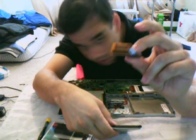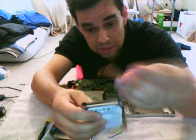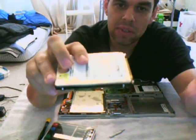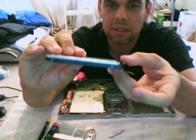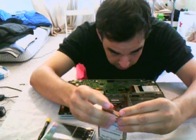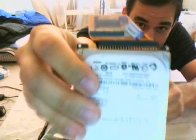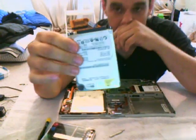Installation is just as easy. This is an idiot-proof cable — it only goes on one way. If you're putting it on and it doesn't fit, don't push it down; you probably need to reverse it. The silver side goes like this — think of it like a little wing on a car. You put it on like so, and I've got to be careful because I've already bent the pins on my drive once. Once you get it on there, go ahead and flatten it down with equal pressure.